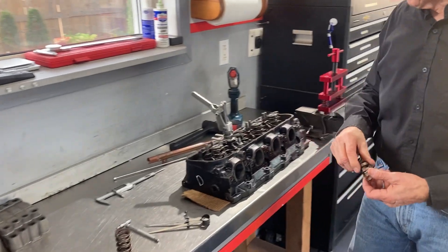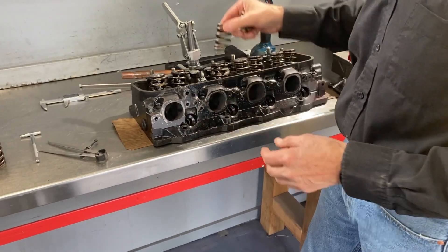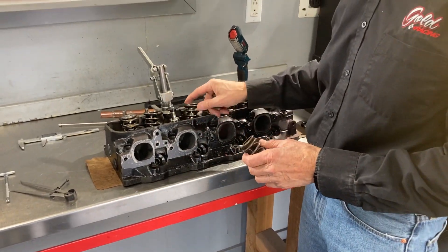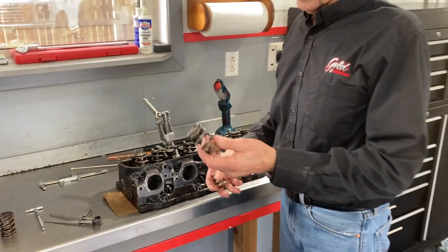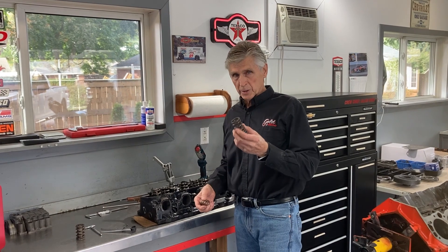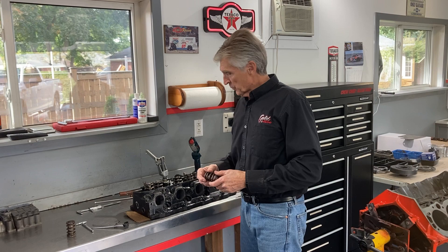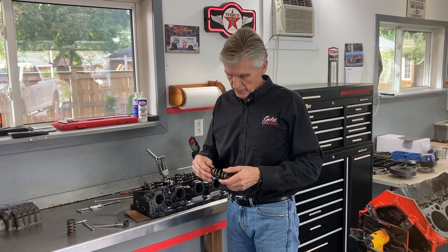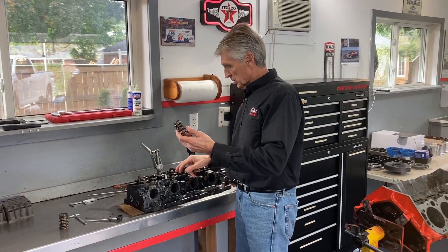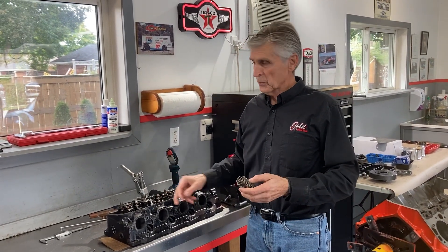When I start this 427 engine up, I will leave the damper out of the spring and install the spring by itself — I will not put any shims in it. I've already mocked up and tested it. I get less than 250 pounds with the valve open using this method, which is real safe. It won't be too hard on the flat tappet of the camshaft. Once the camshaft's broken in, I put the damper back in and set the install height at 1.900 inches plus or minus 20 thou, and we're good to go. The engine's ready for the dyno. Hope you found that interesting — thanks for watching Gold Scratch.